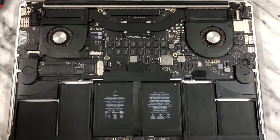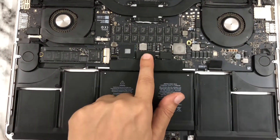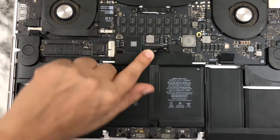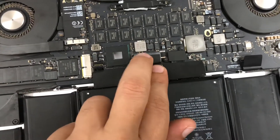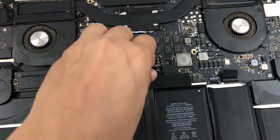Here is the battery on the bottom section. There is a connector to the motherboard on the front of the battery. You can fix many issues by disconnecting the battery, just connecting the charger, and checking if the MacBook Pro is booting or not. This way a lot of problems get resolved.